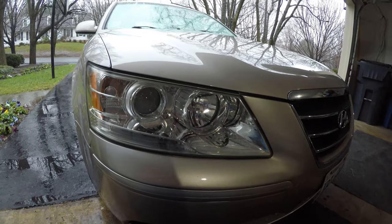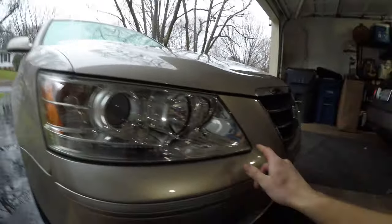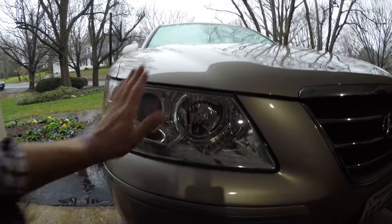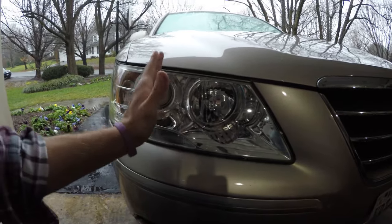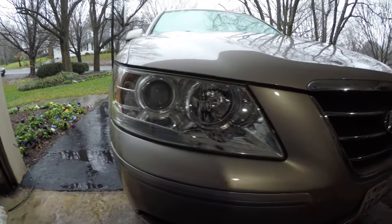The headlight is all cleaned up. I finished it off — I had to go back and do a little extra work — but look how clear that headlight turned out. Don't be afraid to redo a couple of steps. I had to because I was only completing half the headlight during the compounding and polishing. If you want your headlight to look like that, follow those steps. Remember, you can repeat any of those steps — especially the sanding part — if you don't sand out all the imperfections at the beginning, you'll have to go back. Thanks for stopping by, and have a good day!